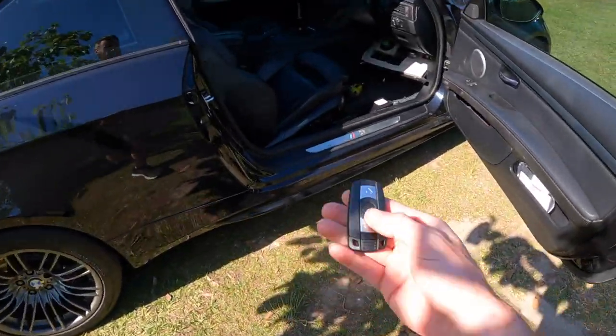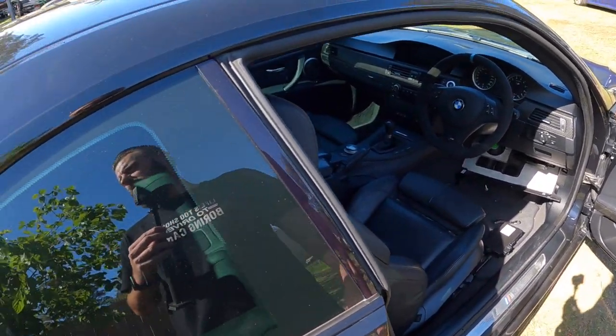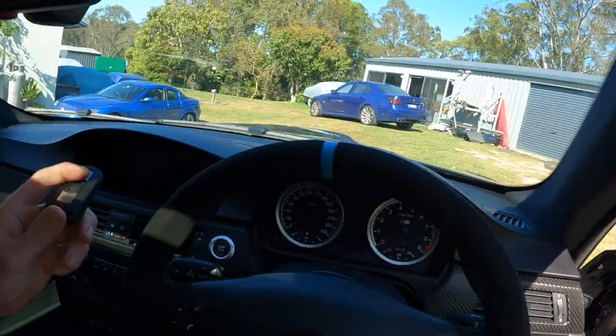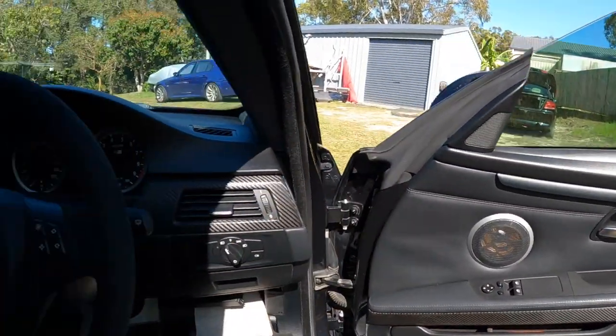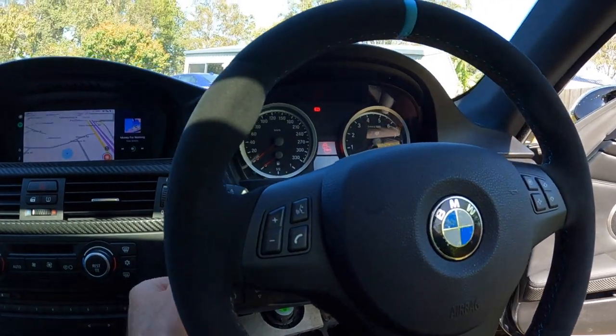Battery reconnected. This is the comfort key — the buttons don't work, but will it power the car on? It does. We're getting a synchronization error, which I was expecting — probably because that CAS has been in the other car. I might grab BIMtool and see if we can get the keyless working. We're not having fun today. I'm going to end this video here. The modified EEPROM on the duplicated CAS module allowed us to start the car, but none of the key functions work. The keyless start would work with the key in the car but you couldn't unlock or lock the doors. BIMtool cleared the electronic lock fault that happened when we put the duplicated CAS in, but the keys it created just don't work properly.